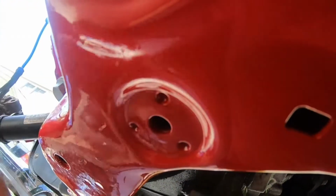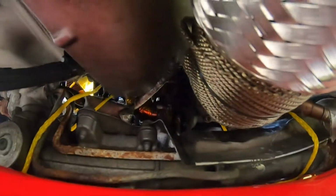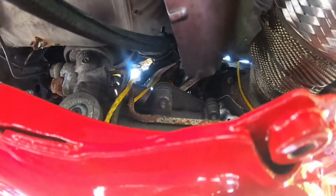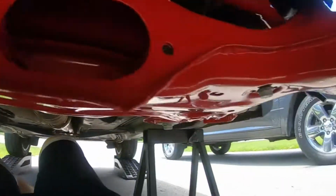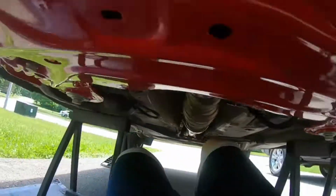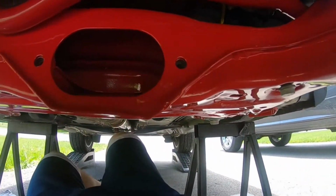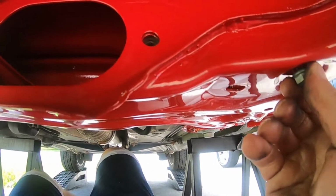So the 4 holes, that is for the steering rack, so you can see it. I'm gonna just maneuver around with the rope there, and again, it has those little grooves, so it should slide into place, and then away you go. So coming along here, got one here, one down there. Do a little cross pattern. Just double checked the old bolts. There's no washers that go on here, so these are just the straight bolts that go in.